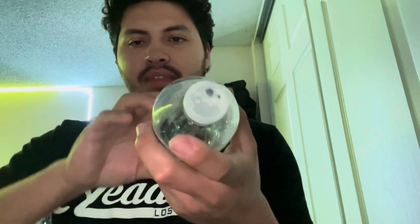So what I'm gonna tell you is try to line it up as best as possible, the big pin to your little line, and when you're installing it, just pay attention to the rotor on the other end. And basically when you're installing it, the thing is gonna turn because of the little splines that it has. The rotor is gonna turn, and you're just gonna have to play around with it until it lands exactly where cylinder 1 is at. I hope that makes sense.